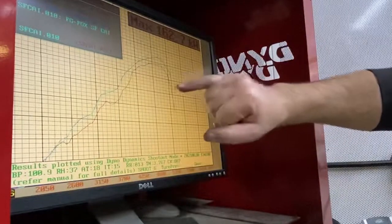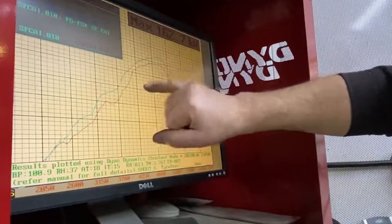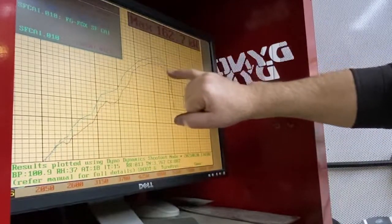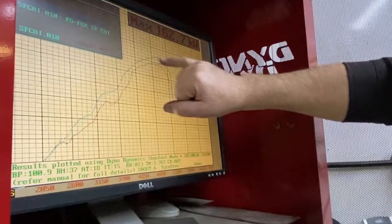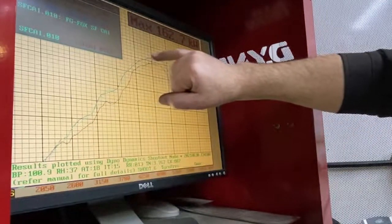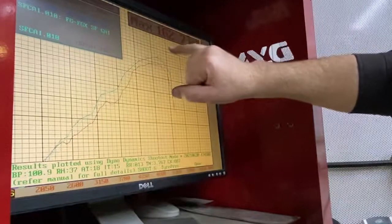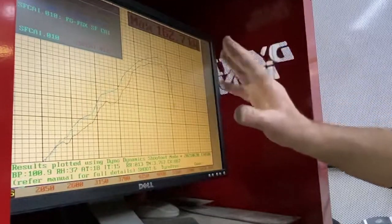Here's our results. Brown standard airbox, that 153. Dark blue Street Fighter full cover airbox, about 160, 161. It's about an 8-9 kilowatt increase. And then the race cover airbox, as we said, didn't expect too much on the dyno, but still gave us a good kilowatt to 2 kilowatt increase. So that's a pretty comprehensive test.